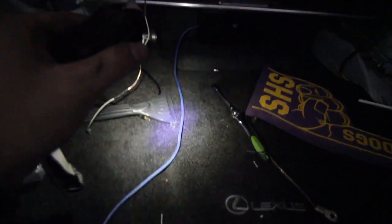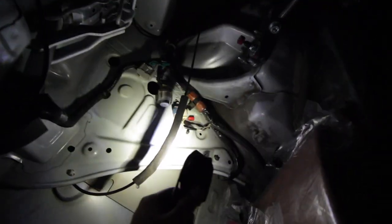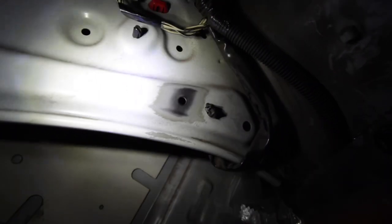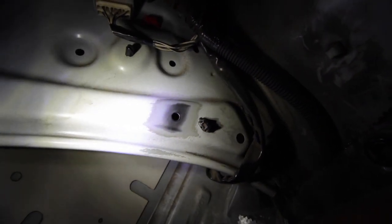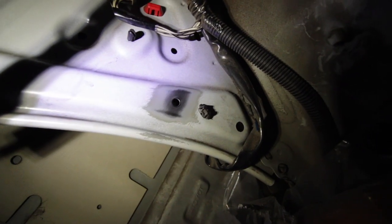If you guys have the factory OG wiring, I'll just unzip it away. Make sure you open that plastic back piece in the back so you can put your hand through and just throw your wire in there — it'll come out through the back. There's your power wire. For your ground, find a nice flat spot. I got some sandpaper — 600 grit or below, so 400 or 100, whatever you pick. Sand the bare metal really well, then grab your wire brush and wire it thoroughly too. Sand it and wire brush it until you can see the bare metal. This does have a lot of paint on it, so it took me a while to get to bare metal, but definitely get there so you have a good ground for your amp.